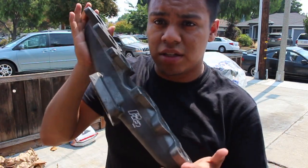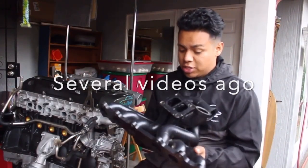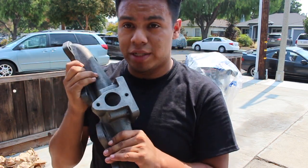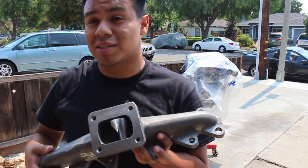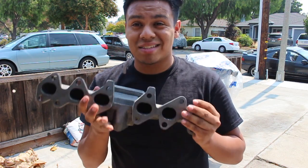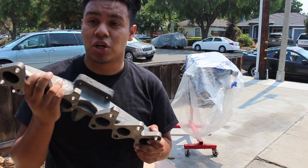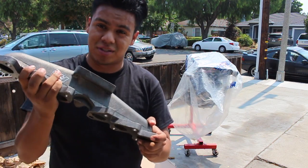One of the cooler pieces in the kit is the turbo manifold. Compared to the one I used to have with the twin wastegate twin scroll setup, this is a much simpler design — but honestly it's really all you need for a single turbo build. The wastegate connects at the bottom flange, and your T4 is on the opposite side. It's a cast iron manifold, so this thing is capable of around 900 horsepower, maybe a little more depending on your mods. Cast iron is basically what most of the 2JZ is built out of, so with supporting mods you can see some serious power.